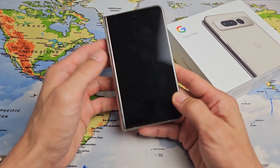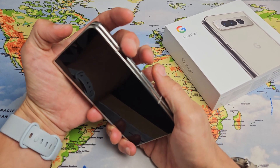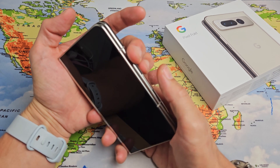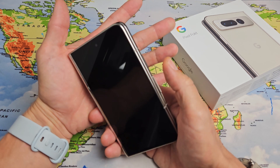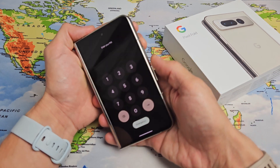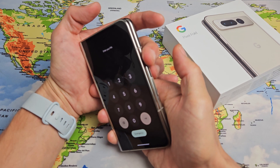So here's a possible easy fix. It doesn't matter if the phone is closed or open — we're going to restart it using a two-key combination. It's going to be the power button and the volume up. Press and hold both buttons for 15 seconds, then let go. Let's pretend I'm still stuck in a boot loop — I see the Google logo right there, now it turns off.